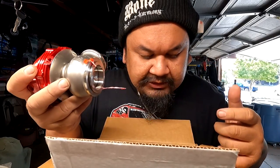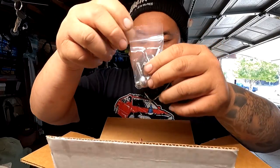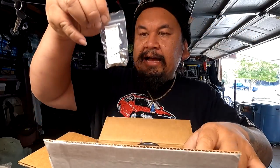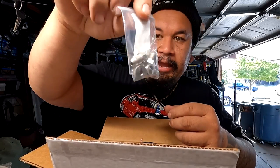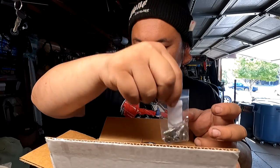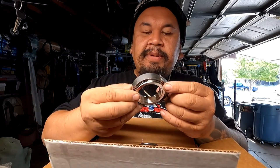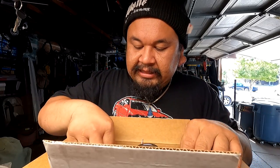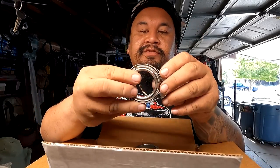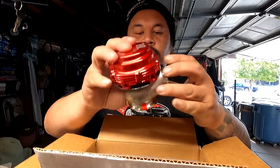It's got the firing ring on the inside and the spring is already in here. We have the banjo fittings for the vacuum lines, the fittings and block-off for the water port and the vacuum port that we're not going to use. We have the V-band clamp, and this is the flange that goes on a turbo manifold if you're building a custom turbo manifold. We also have the clamp and flange for the discharge of the dump tube. So Tial wastegate is what we're rocking with.